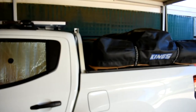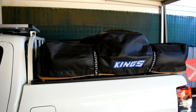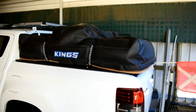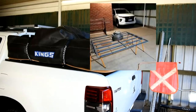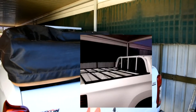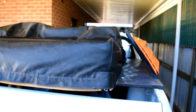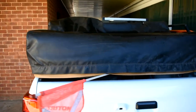Generally speaking, the rooftop tent is supposed to go on the rooftop. However, I don't like the look of a rooftop tent on a rooftop — they're too large, too bulky, and they act like a parachute. So basically what I decided to do was manufacture my own tray rack. A lot of companies sell tray racks and they're generally around $600 or $700, but they don't sit flush with your tray and you end up with big gaping holes down the sides. So I've got some steel RHS welded together into a strong rack and mounted the rooftop tent on that.